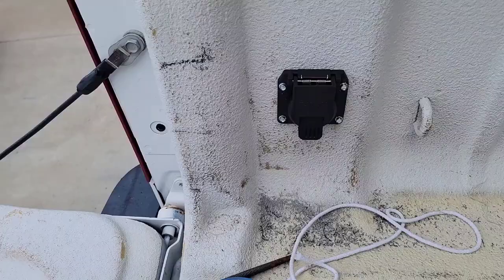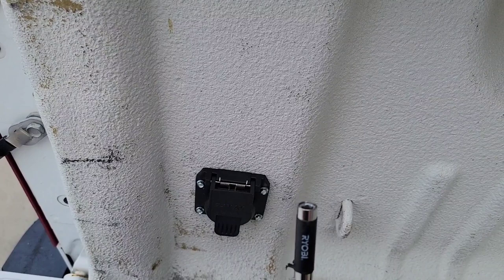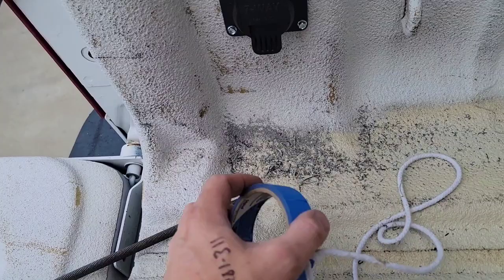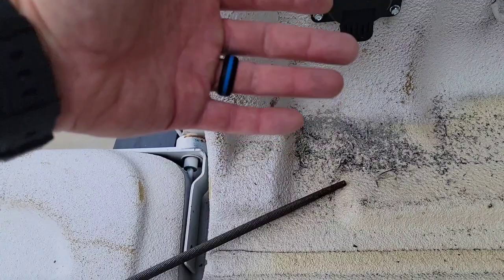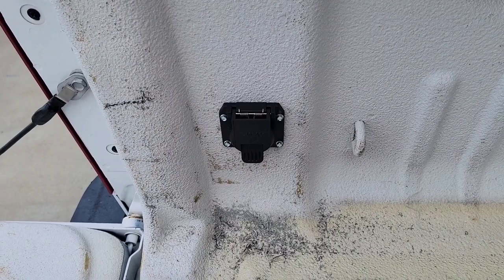Super easy. This is basically a quarter-inch, 7 mil, 8 mil — whatever you want to use. Got that in. We'll put a tester on it here in a second. I've told you guys before — this might seem stupid, but don't try and sweep this metal shavings up with your hands. Metal splinters suck. So we'll clean that up with a vacuum. We'll put a tester on this and get underneath to see if there's any place we want to zip tie. That way we can confirm that we got the back one still working on the bumper and this one. Again, this is less than 40 bucks. And even if this flapper breaks off over time, the cover will still be good. This has a bed cover on it so it won't see a lot of rain. But you can also save yourself a hassle by putting some dielectric grease on there.